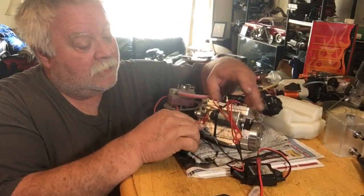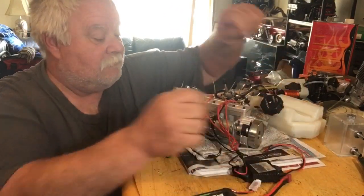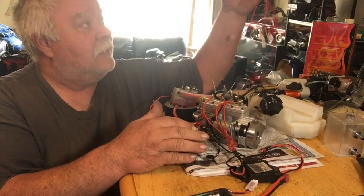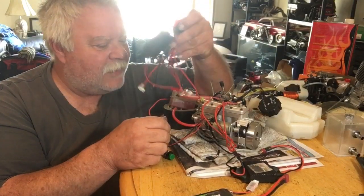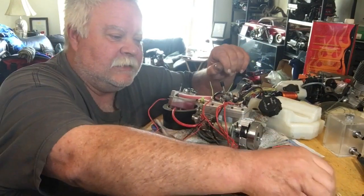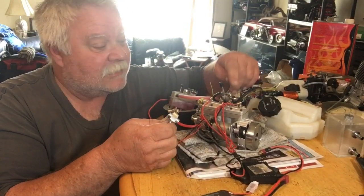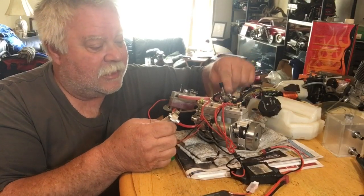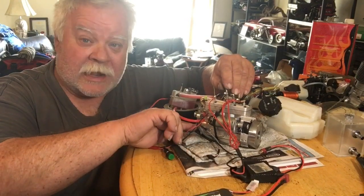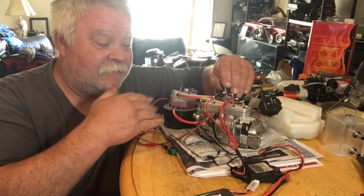What do you think guys? Today we're gonna go over a few things that I did to this thing. I really looked the engine over and I had it running on gasoline with the CDI unit and it just didn't have that rev that I wanted — it was really slow, all jerky. I was having trouble with the carb, and I see a lot of people change their carbs right off the bat. So I changed the carb, tried it on gasoline, still ran kind of the same way. And then I think my hall sensor down here — I don't know if the timing keeps moving on it, or if the magnet maybe hit the hall sensor, because now it ain't working.